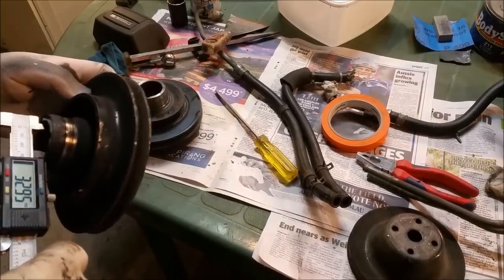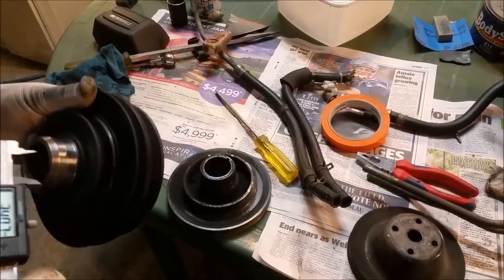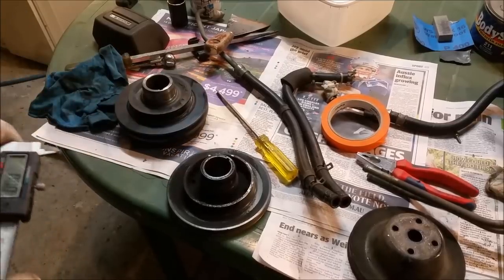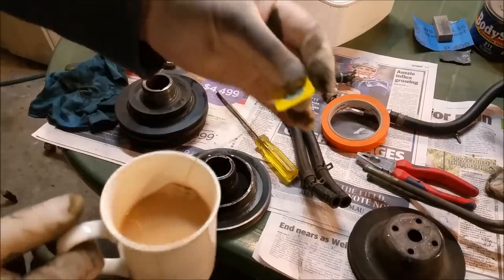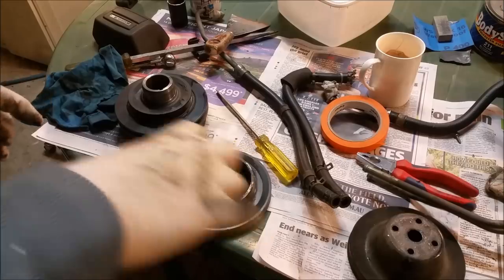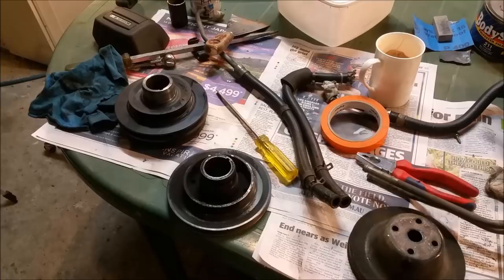The Japanese gearbox for a 2 litre apparently fits off an earlier car but finding one of them is going to be murder. So we're stuck putting the original 2 litre engine back, which doesn't bother me at all - saves me some money. There are cross member differences apparently, which is no big deal - I can get a cross member and tail shaft. Some people say you just take the plate off the Japanese one and get a shorter one to move it forward, but others say you need to change the innards around the extension housing.